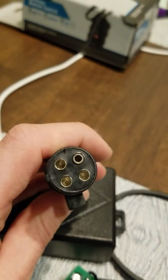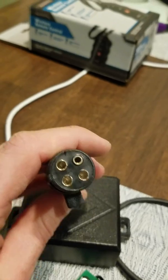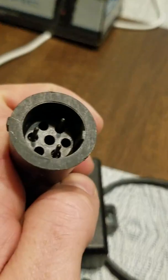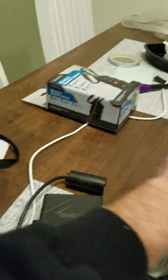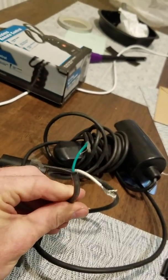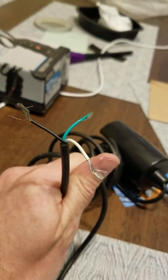The connector on the Traveler had a four-pin and my winch had a three-pin. So I took it apart and figured out that mine has three wires coming out of the old controller: black, green, and white.